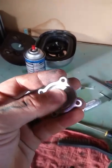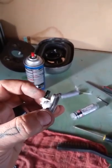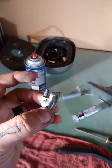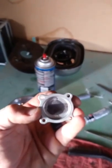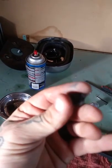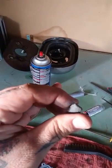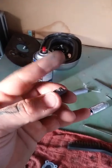You want it to stay where you can still get that diaphragm in there. We're going to fill this one up some more, making sure we really pack it down. You want to make sure you get your edges nice and flat and smooth. We're going to top this off by putting a vacuum cap on there to fully seal it, in case of any possibility of fuel coming through. That vacuum cap is going to be glued on there. This stuff - once the two components are kneaded together, it starts to heat up and hardens within an hour to be rock solid. So you want to move fast.